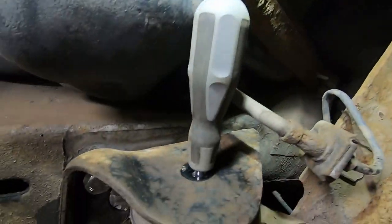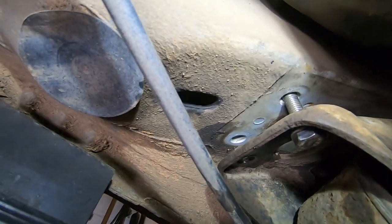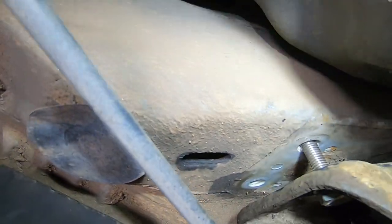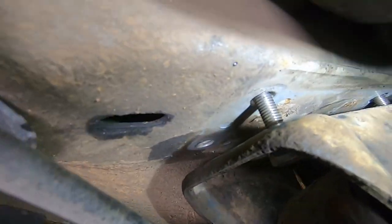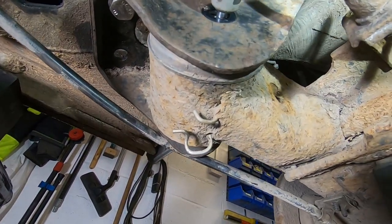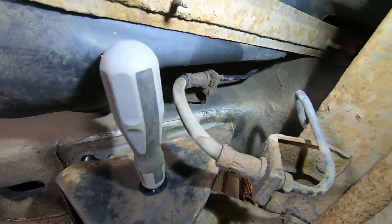So, on this side, to clear the fuel tank, I had to take off those bolts, like I said earlier. So what I did is I took out two and put some nice long M10 bolts in. Can you see those? I put some nice long ones in to lower it down and took the weight on the jack and then slid the bolt out. So I haven't actually undone that bracket yet up there, but I will do.